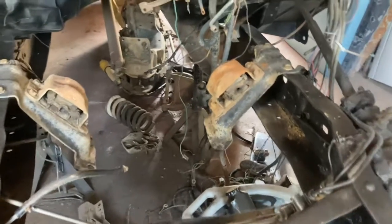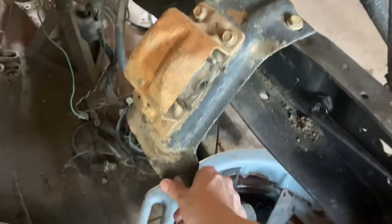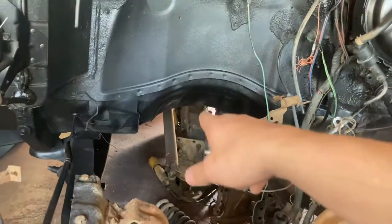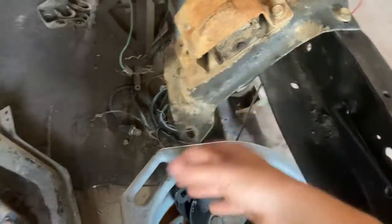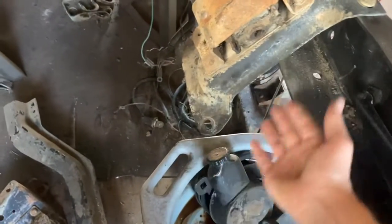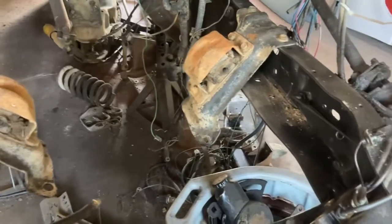I ended up coming up with a simpler solution. I'm going to use the two-wheel drive mounts because they already have holes and go where they're supposed to. They do flex a little bit because they don't have bracing at the bottom, so what I'm going to do is take that cross member and cut out the sections that go right here — just a little bit of a brace — and that should be strong enough. Then I'll put the four-wheel drive cross member in. So it's kind of a bastardized two-wheel drive, four-wheel drive combo.